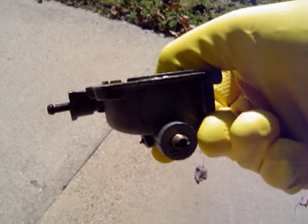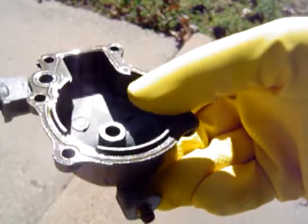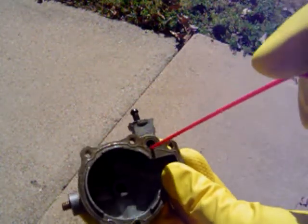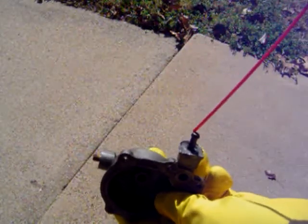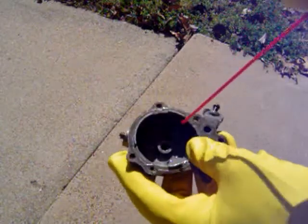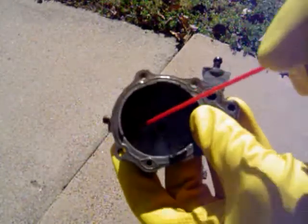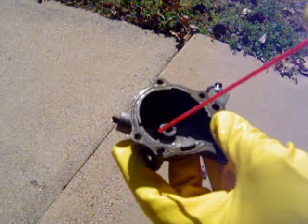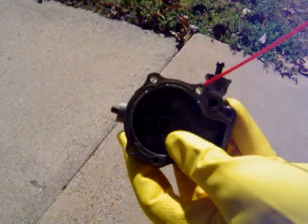For time purposes, I went ahead and placed the high speed nozzle back in, just briefly, because all I want to do is spray it out a bit. I'm going to be spraying different areas — you see right here, this goes out to here. Make sure this is clear. Take the little straw in there and make sure all that's clean. Right up in here, because this is where the high speed is. Spray that out, and this little hole right here, because this is the communication passage. Make sure all that's clear.